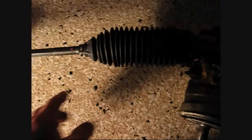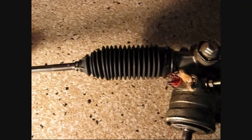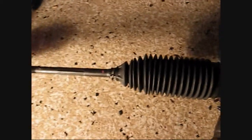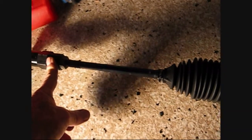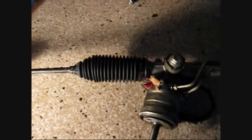There's some special grease — you want to grease the worm gearing in there. Then put your tie rod end back on, find your mark, tighten it up, and that's about it.